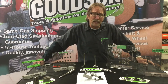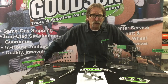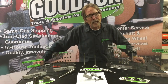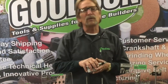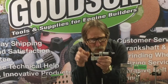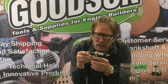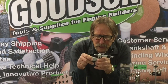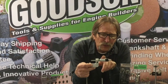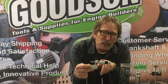It's a very accurate tool for cutting multi-angle seats simultaneously. One thing we missed out of the equation last year was a setting micrometer for setting the diameters of the tool. We actually lost our manufacturer on this tool, and the biggest reason was direct reading micrometers — a direct reading micrometer is very expensive.